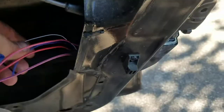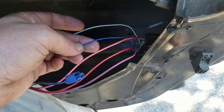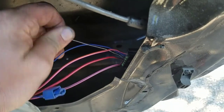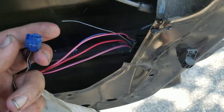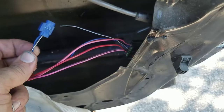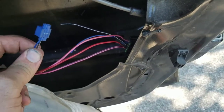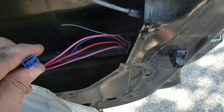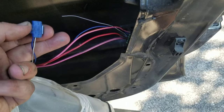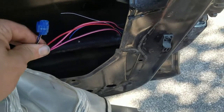The wires you're looking for are the dark blue wire and the black and white stripe wire. This is a butterfly connector — just a fancy way of connecting these two wires. You can cut them, twist them together, and black duct tape them, or you can pick up one of these fancy little connectors, squish it closed, and it connects the two wires.